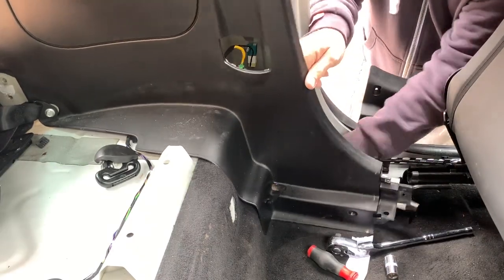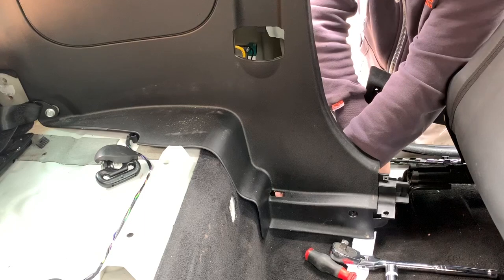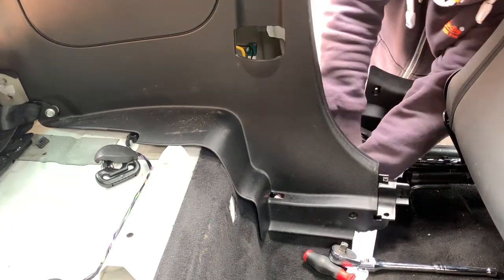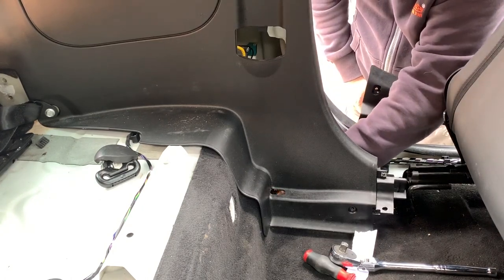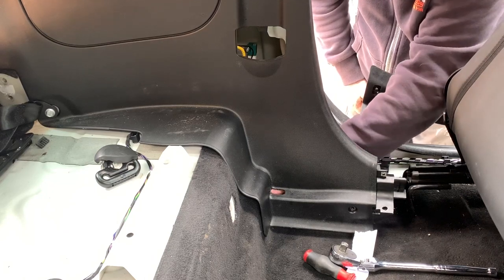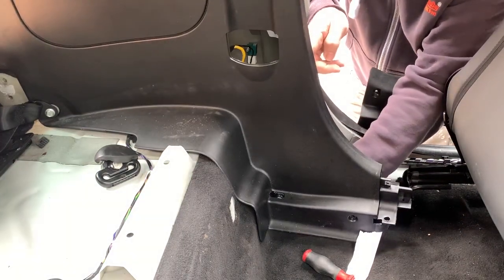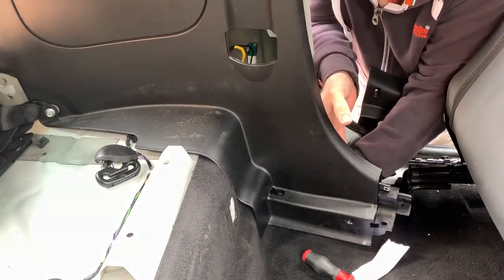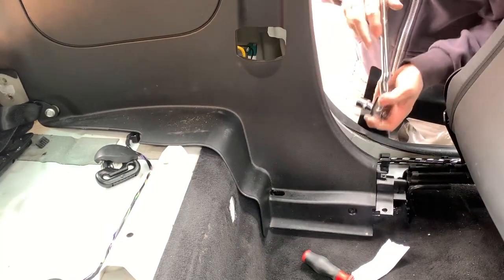Now we have to get that through there. It's best to do it before you can. What I've done is put the bolt in first - it's actually a very good approach. Do that up by hand as tight as you can first, and then get the socket wrench on it. There's no room to get an impact gun in at all, so you've got to do it with a wrench - but it does save you any grief of breaking that bolt on the seat belt.